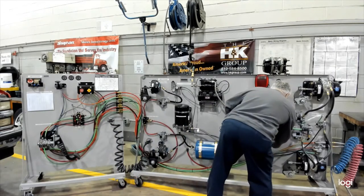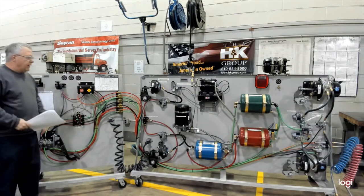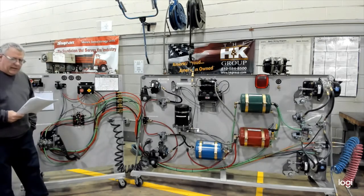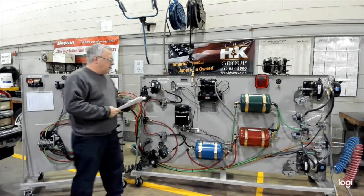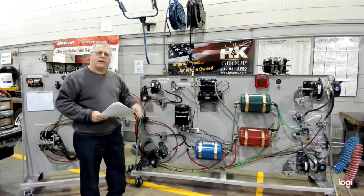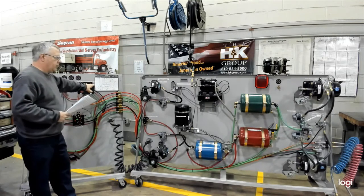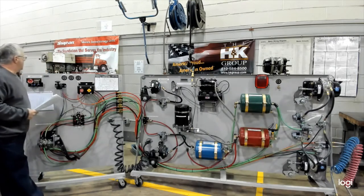Number 11: close the drain valve in the secondary reservoir and rebuild the air. You can watch your light go on and then go off at about 65 psi. We're going to do the same test for the primary system — we're going to check that if we lose air in the primary, will the secondary maintain air and will the parking brakes stay released, and will we only lose air in one system. Wait for it to kick off.